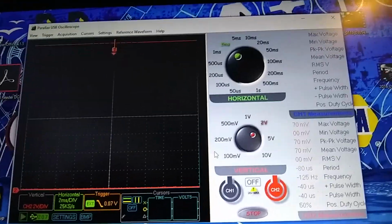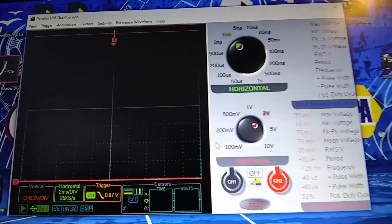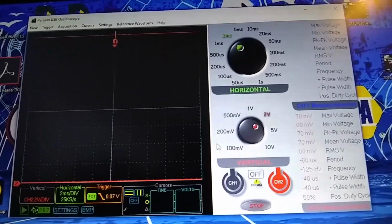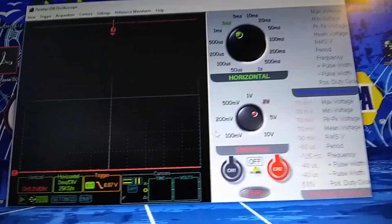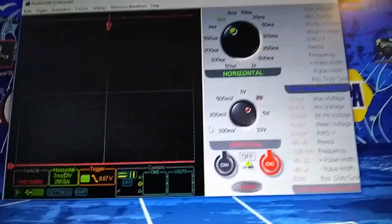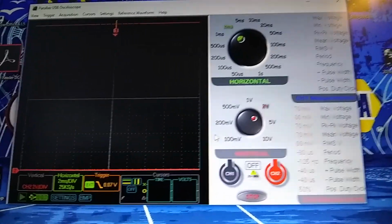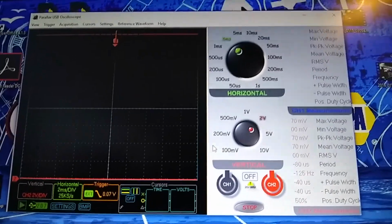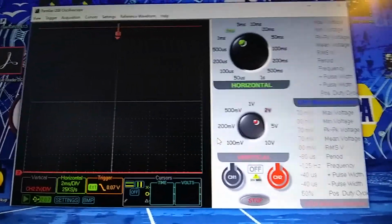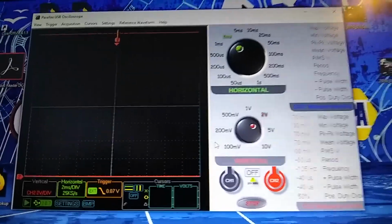But I think if the motor was starting to draw more current, we would see the voltage drop faster, right? And we would still see a change when we click that switch. The fact that we don't see the change tells me that it's something in that fan regulator where it is getting hot and it's only putting out so much voltage, even on high, and until it just doesn't regulate it down. That's what I'm thinking. I guess we'll see if I'm right.